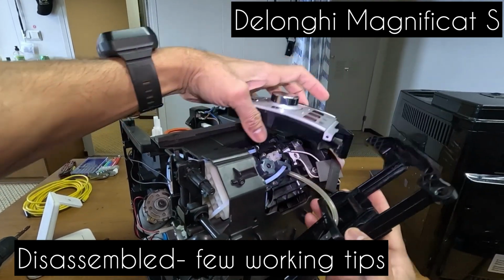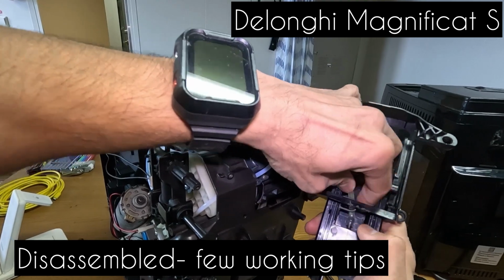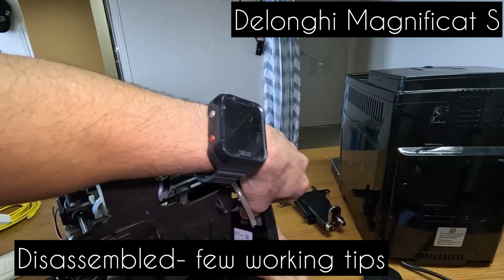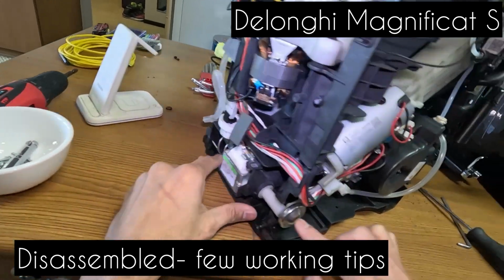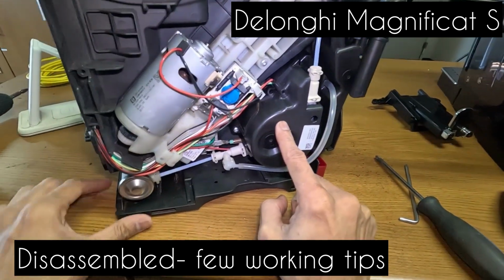This is your final coffee dispenser, the nozzle. You just carefully pull out the pipe, and you can keep this at the side. This can be just here for a bit. It's not too heavy. See how the flow goes from the water pot. This is your pump that takes the suction, delivers it to the resistance, which has a heater inside. So that's how it delivers.